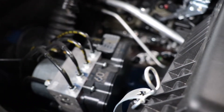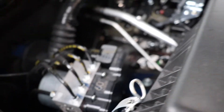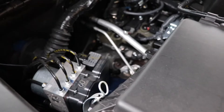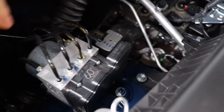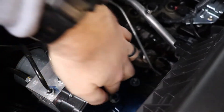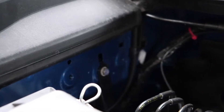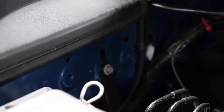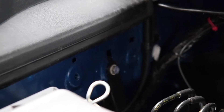Where the bracket actually resides is right over top of your ABS sensor junction. We'll zoom out a little bit — it's right behind your airbox. My truck's totally stock, so it has the stock airbox. It goes right there. We're going to loosen this bolt right there. There are also two pre-threaded nuts right into the body, the side of the inner fender, where two bolts come with the SLEA off-road bracket.